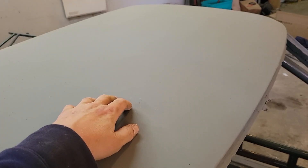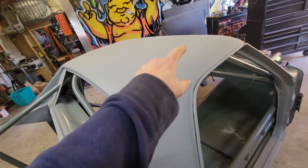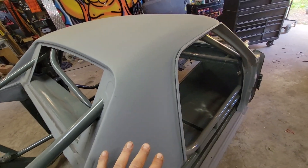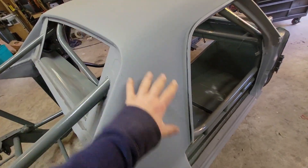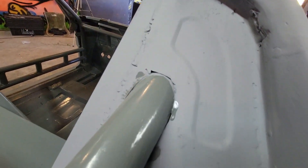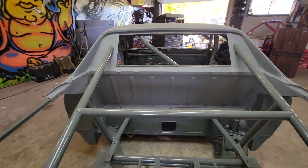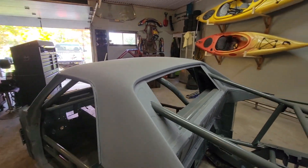Right here in the roof there was a massive hole. I fiberglassed underneath so you don't really see it too much. On the sides here, you can't really see where they were because I did a pretty decent job, but there was a big groove in here on these El Caminos, and that's where the roof skin attaches. This car was originally a vinyl roof car, so there was a lot of work to do on the roof. After I did the body work, I sprayed the primer on it - it's a high-fill primer. On this side I still have a lot of work to do. That's another seam that's in the body panel stock.